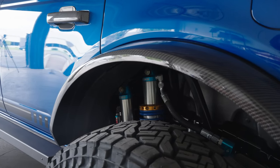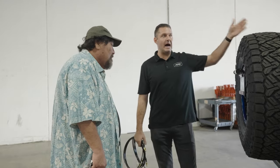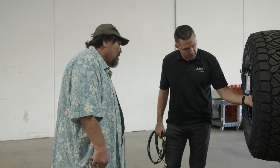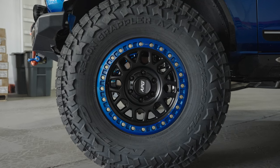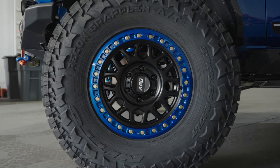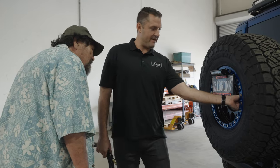We're just going to quickly talk about deflation. I'll use this one right here since this is your spare — don't have to bend down. So if you want to deflate your tire, the Bronco's got live tire pressure monitoring sensors. The second you lower the air pressure, it's going to display on your dash or your app. To drop your air pressure, you've got two ports — your factory valve and your secondary Apex valve. Unscrew the outer — it's like a valve cover, just a regular cap. And then you see a little red knob right there — just pull back on it.